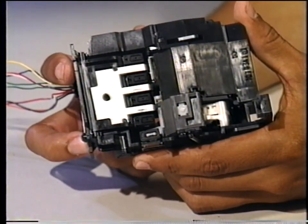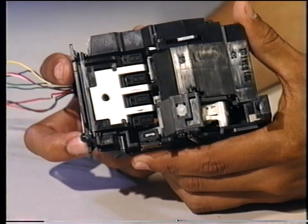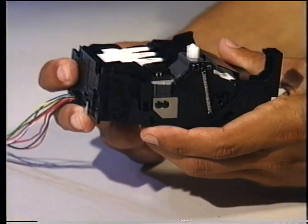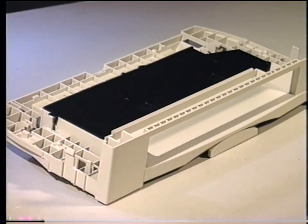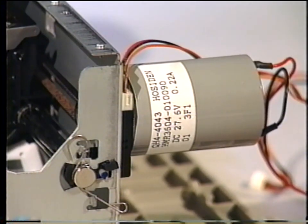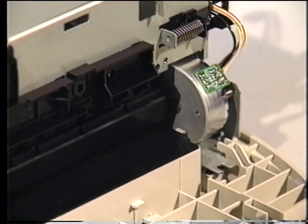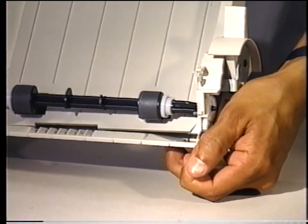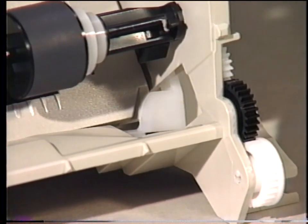The carriage will automatically move the selected color printhead to the suction cap during a cleaning cycle. The four protective cap units cap the printheads to prevent them from drying out when the printer is either powered off or not printing. The printheads are capped when the carriage unit is moved up by the white locking pin. The waste ink is deposited into the ink absorber pad in the bottom of the printer. The carriage is driven by the carriage belt, which is driven by the carriage motor. The purge unit has its own motor. The paper feed mechanisms and sheet feeder are driven by the paper feed motor. As the gears begin to turn, the cam is released, allowing the spring-loaded lifting plate to lift the paper up to the pickup roller. The paper selector lever moves the corner arm.